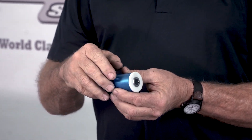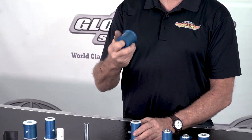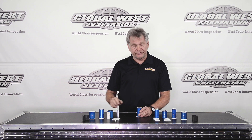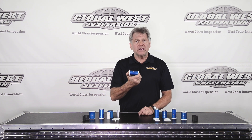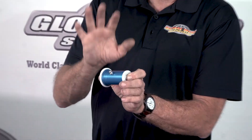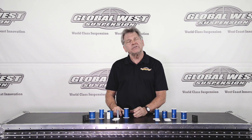So you can lube these while they're on the car. Inside the housing, it also has grease grooves, channels for grease to get through the bushing. So now you don't have any squeaks. But when this goes in that frame and you torque down, it torques against the steel pin, and so this bushing floats. It goes up and down smoothly with no trouble whatsoever. It removes any bind in the suspension.